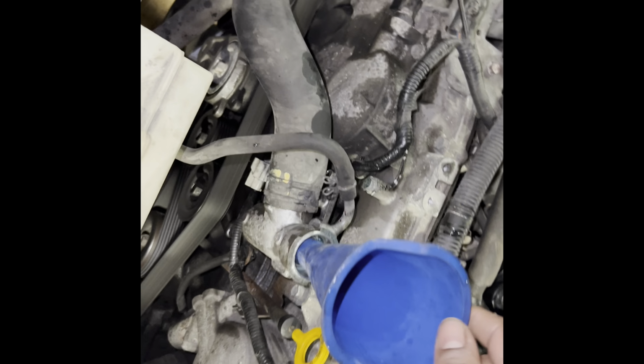Top everything up, rev it up. They put it on an incline where the back is down and the front is up a little bit, like my jack stand does it. Rev it up, come back, open it quickly, let it shoot out so all the air comes out. Then you top it up, cap it again, rev it up again, and come back, open it. There are different methods of doing it. I think this method would have worked out.